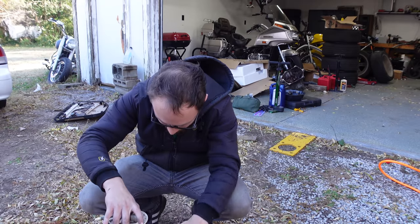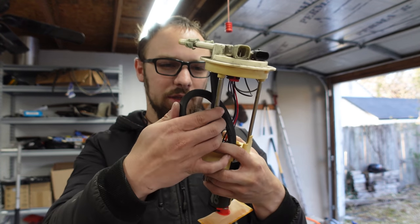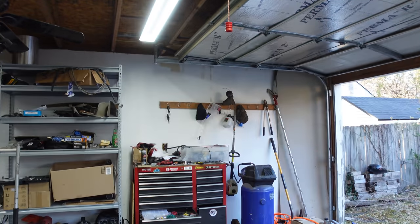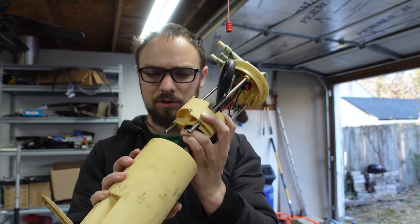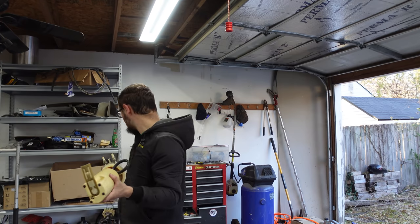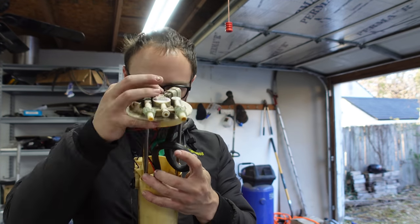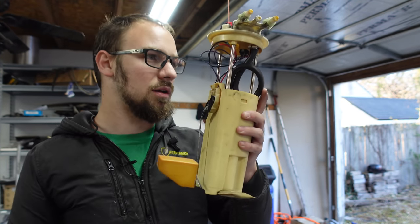My mic died so I didn't really film much of this, but it's really nothing you haven't seen before. We put new fuel line on here, stuck in the fuel pump, crimped the wires, and now this is ready to be fed in. I have to figure out how all this goes — something like that, there we go. The reason for the seemingly excessive amount of fuel line is so that it doesn't exceed its own bend radius.